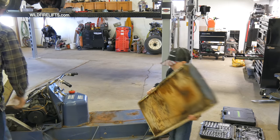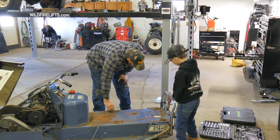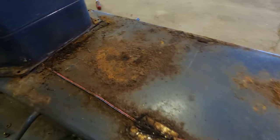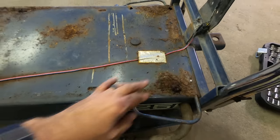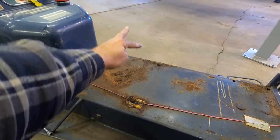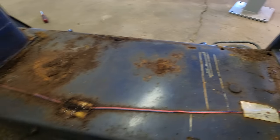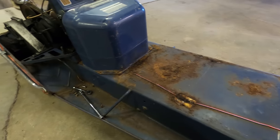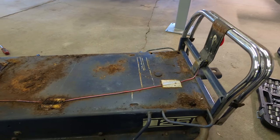We've got some weight reduction! Oh, it's not too bad. Yeah it is - a couple holes. Now I know this was meant to be. She's got some weight reduction on her. Some of this is just surface rust starting, and then there are pin holes. We've got a couple holes back here, so I'm probably going to clean this up a little bit. Going to have to try to save it because once these tunnels go, the sled's pretty much shot.